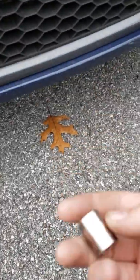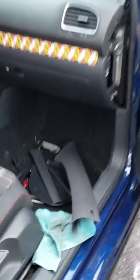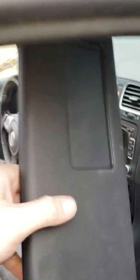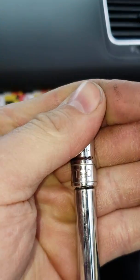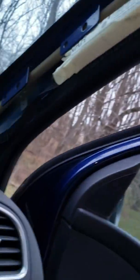I mean, ratchets. To get the wiper arms out, you pull a little clip off, and then you use a 1/2 inch, and that pulled right off. And then with all your pieces to take out, to basically drop this down a little bit, it's a T20 Torx bit, and that will work for all of these. Boom, all these little pieces, and the one back in here.